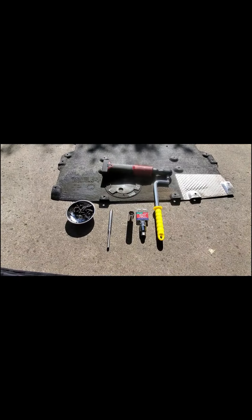Here is my solution. At first I thought I was going to be cute and just order this and shortcut it, but nope — that does not fit. It's a 14 millimeter but it's too long. So what I'm going to do — somebody suggested cutting these off, but that's way too much work — I'm going to take this 14 millimeter hex, put it in a 15 millimeter deep socket, take the tag out, and use a punch to tap the hex out.